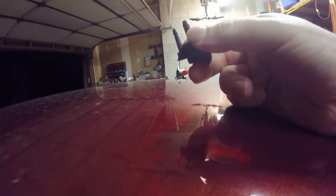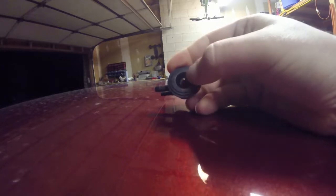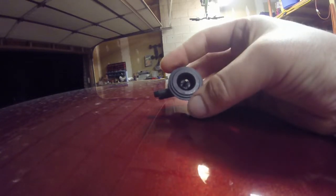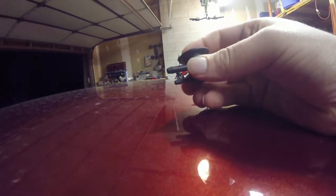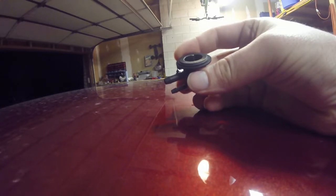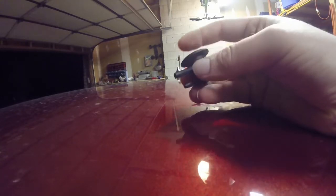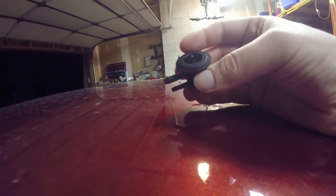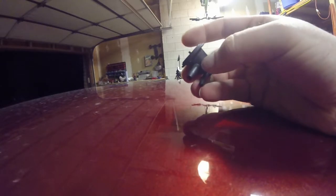One of the things I want to talk about is that third little nipple on there. What this does is it's actually a vent — when you've closed off air to one section, you actually allow a little bit of controlled air into the other section. My one fear is that the hole is too small. If that's the case, I'm going to prove this theory by running a T off of this main line. If I get the duty cycle too high and it's working but not going as high boost as it needs, that means this bleed vent right here is not big enough. I can either add a T out here on the main line to do some of the venting or something along those lines.